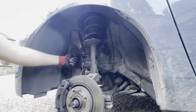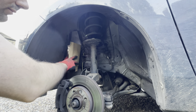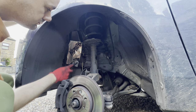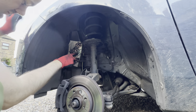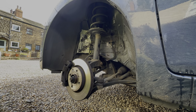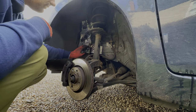After checking the wheel arch to see if it was dry enough, I began to use my tried and tested method of applying sound dampening mats — just size them up by molding them, then cut them to size and apply. That's the magic. I did use rollers to make sure the sound dampening mats were fully flattened, which is especially important here as you don't want them peeling away. That said, this stuff has really good adhesion so I'm not too worried, but I wasn't fully confident in my mass loaded vinyl setup, so I decided to stick just to sound dampening mats for the exterior wheel arches.